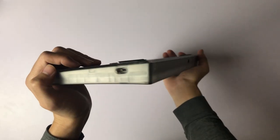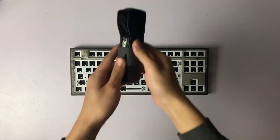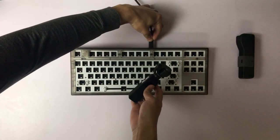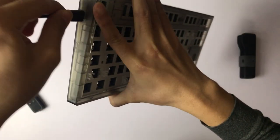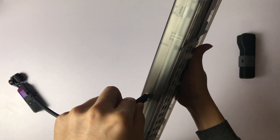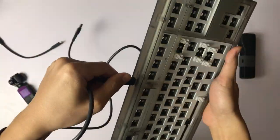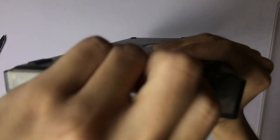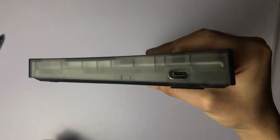The PCB has three Type-C connectors, but no pass-through. This means that you cannot utilize the other two ports for things like charging your device or connecting other devices through your keyboard to your computer. And it will just sit there waiting for you to someday change the position of your cable. I can't even plug in my own cable because the area is too small. Others might find it handy if they change the board from time to time, but I find this design somewhat redundant and ruins the aesthetic of this board when looking to the side.